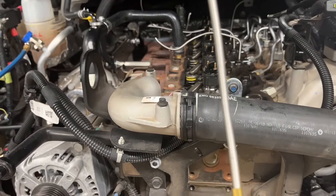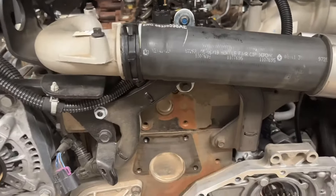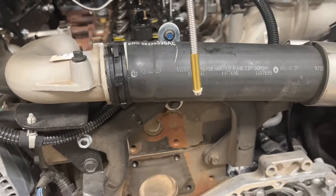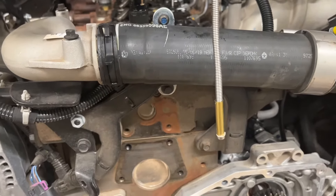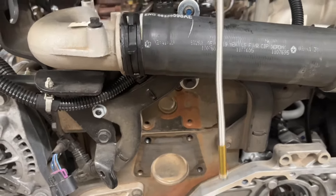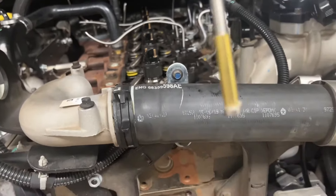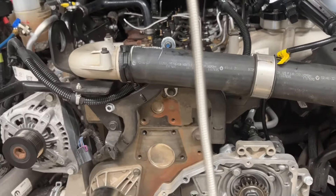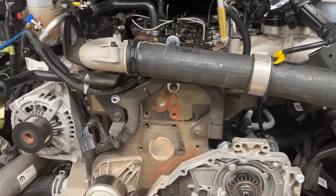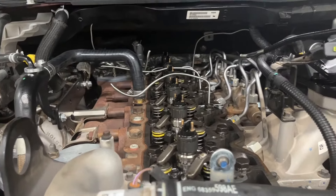I like to make the magnet straight and then do a slight bend towards the cold side. This allows me to insert it into the bore more easily, and when I hit the lifter and it hits the side, the bend helps rotate it into the cup. In the future, running a piece of hose clamped with crimp clamps might be the best course of action, because the magnet sticks everywhere. I haven't seen anybody else do this with a non-dealer tool, so I'm kind of learning as I go.